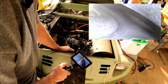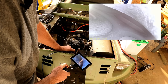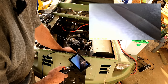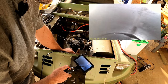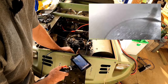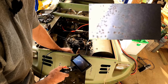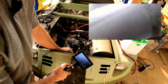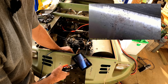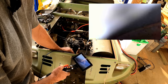Well, that's not what I was expecting here. Huh. Okay. Well, I'm immediately seeing valves, even though I'm going straight in. And that to the right must be the piston. There it is. I see a little bit of junk in there. That may be... what is that? Surface rust? That's what it looks like. But man, it's nice to be able to just kind of look back and forth when I'm in the cylinder. It's so much easier to look around than with the other scopes where you have to change cameras. Problem is I'm not loving what I'm seeing here.